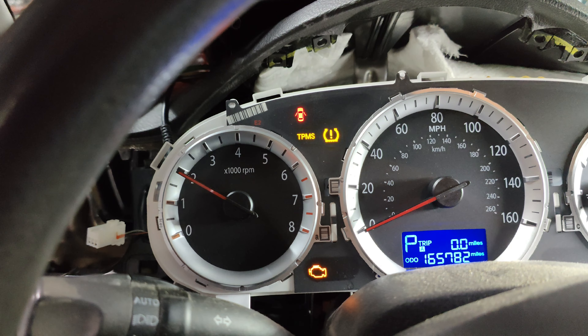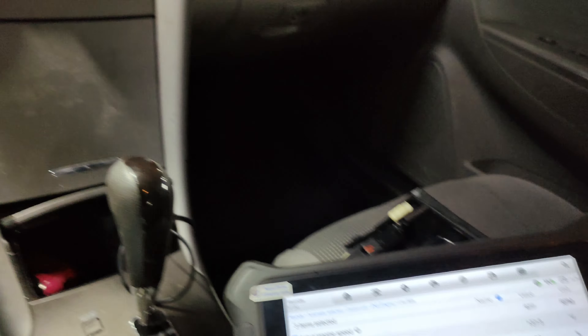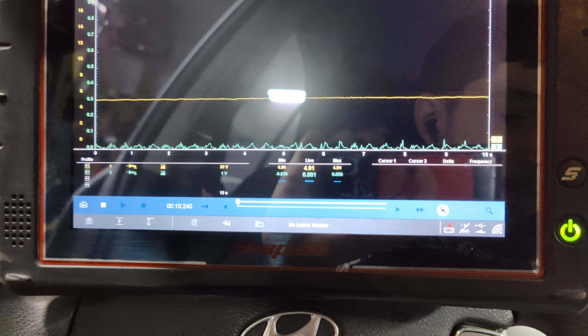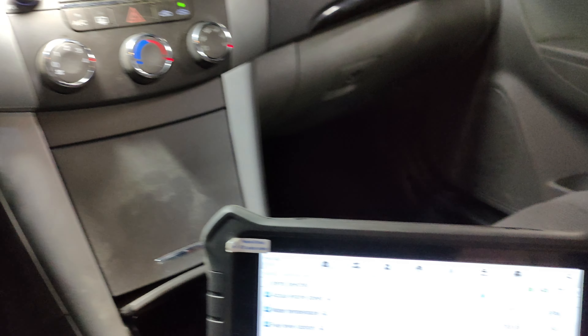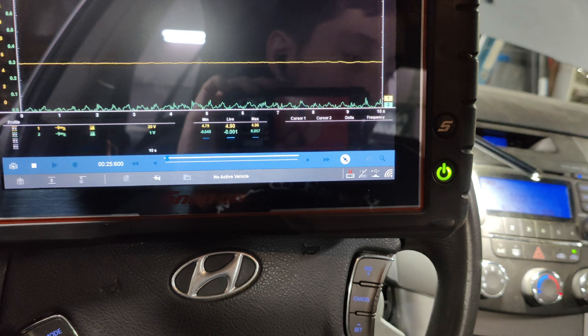Look at that, it just dropped for no reason. And it's only on the signal side. Look — and then our temperature spiked up. See it right there? Let's see if we wiggle this. There's no change in that. Let's see what happens if we unplug it. Spiked up — battery voltage. Plug it back in. It's shorted. So our sensor is shorting this out.